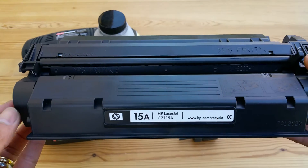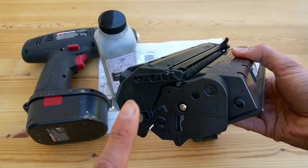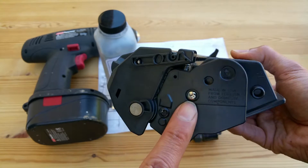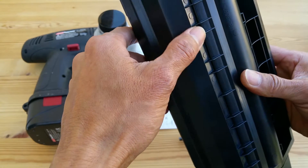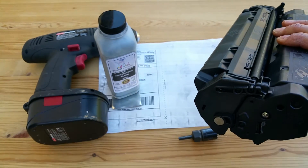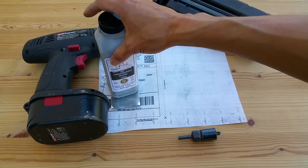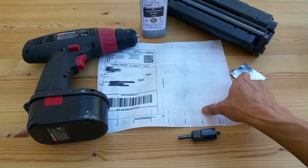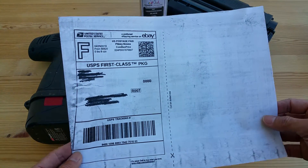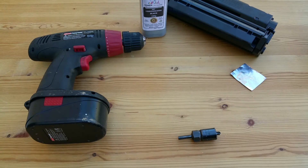As you can see, this is the cartridge — this is the original one. Last time I did the video, I cut this open, which was a mistake because once you cut that open, the roller and the blade will be separated and then the toner will leak out. After I did the printing test, it had ink all over the place and it got spilled inside my printer as well. So that method was a fail.